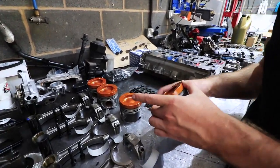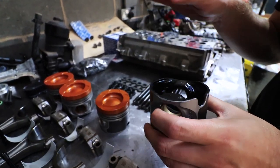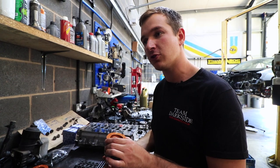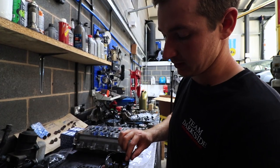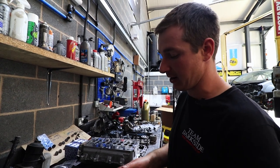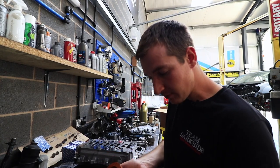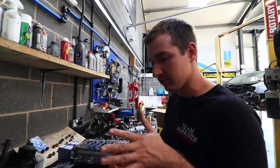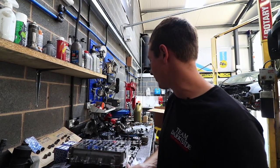The pistons — these are just the factory pistons that we machine out to a bigger hole for the oil ways. We balance them by doing that, so all these pistons are weighing within two grams of each other — very accurately the same. All marked up so we know which bore they came from, so the pistons go back into the same bore they came out of and the wear is all the same. We've had the valve pockets machined so we can put a more aggressive cam in future if we want to, and so we've got a little buffer when things get hot — you're not going to have any valve-to-piston contact. The piston bowl we've not machined; left that as it is because we want to keep the compression high as we're not running nitrous.